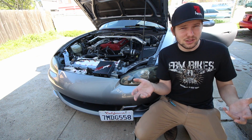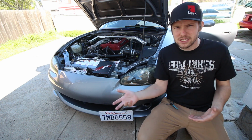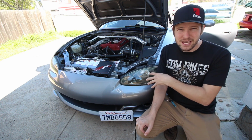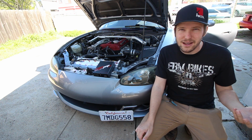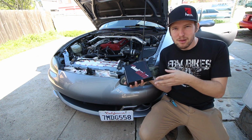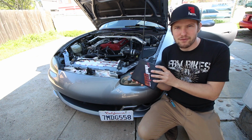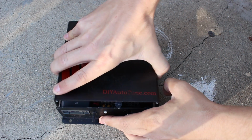Now, I've already done a detailed video on how to install Megasquirt. It was on an early 1.6 car, but this install really is not much different. Doing Megasquirt on an NB is actually even easier than doing it on a 1.6 car or an NA. Mazdaspeeds are fancy. The plug and plays are pretty much ready to throw into your car as you buy them, but you can change certain things around depending on your setup, so I just want to make sure everything is as configured from factory before I put it in the car.